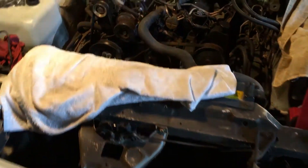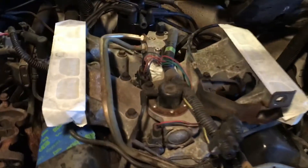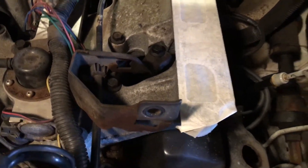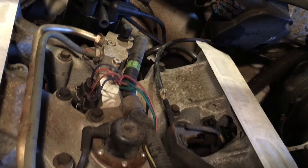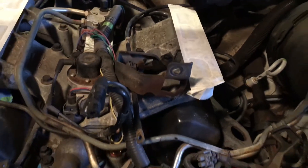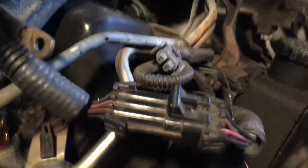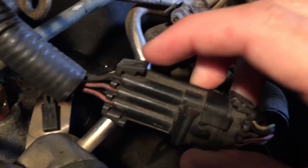We're looking at a 1992 Chevy Camaro and we're going to be talking about the fuel injectors. We've got three injectors on one side and three on the other side. These are wired with blue and pink going to three, and green and pink going to the other three, wired in parallel. The plug for them all is conveniently right here, where you have your pink, blue, and green.